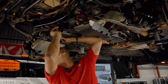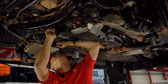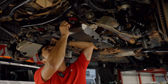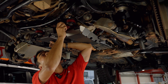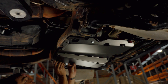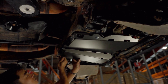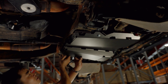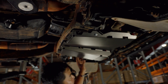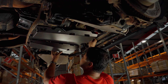This bash plate is specifically designed for the diff drop, but the standard non-diff-drop bash plates install exactly the same. We like to protect and recess the bolts because if you hang up on or hit those bolts on the tracks, you can bend them and they'll either break on the way out or damage the captive nuts up inside the chassis. So I've got those up nice and loose — we'll tighten them up later.